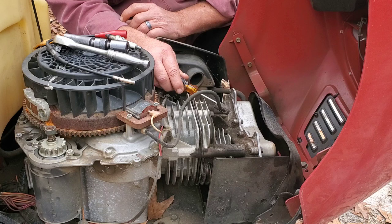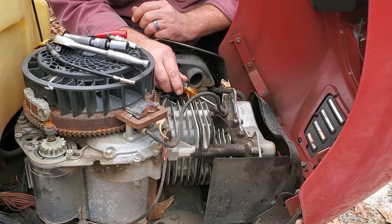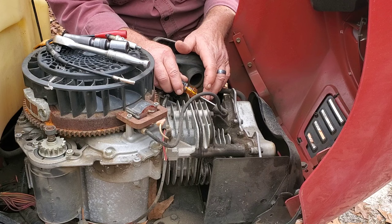Do the same procedure. You can try it first with your wire on — no spark. Okay, disconnect the wire. Now you've got spark — that's a wiring problem. If you disconnected that wire and still no spark, bad coil.